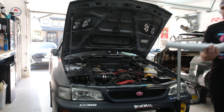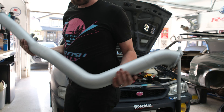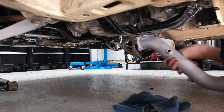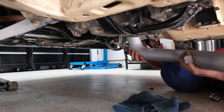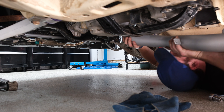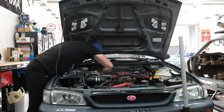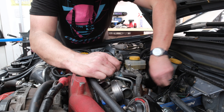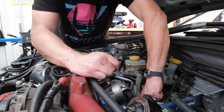Alrighty, so I freshened up the downpipe — scuffed the whole thing down and Sarah coated it with VHT ceramic header paint. You basically heat it up, spray the paint, heat it up again, do another coat. Just use a tiger torch or a propane torch, whatever you've got. Getting the downpipe in the GC8 is not too bad of a task — basically you have to take the intercooler off. You don't have to remove the steering shaft. There are some tough nuts and bolts on the bottom side to get at, but if you have crow's feet and short stubby ratcheting wrenches, it makes it a lot easier. You just have to take your time, really be thoughtful of where you're placing your wrenches and making your turns.